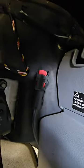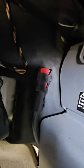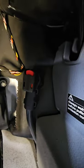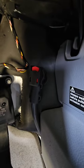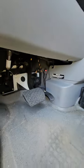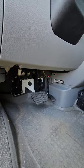Another thing, guys — these vehicles have an isolation switch right here underneath the dash by the gas pedal. Sometimes you have to push that little red tab in and pull that connector off of there, let it sit for a while, and then put it back on to get the vehicle to start up if you've had it in storage for a while. It's called the isolator switch, or isolation switch.